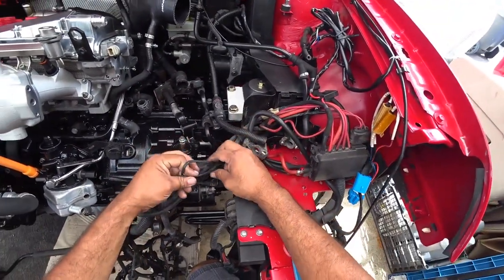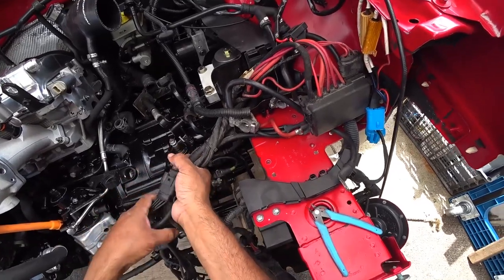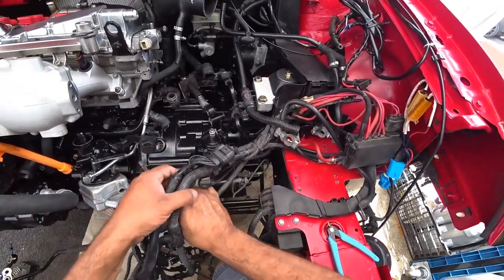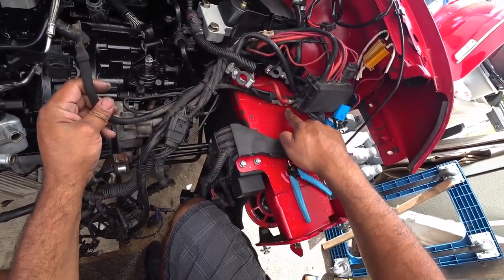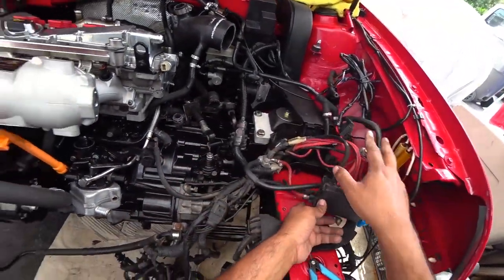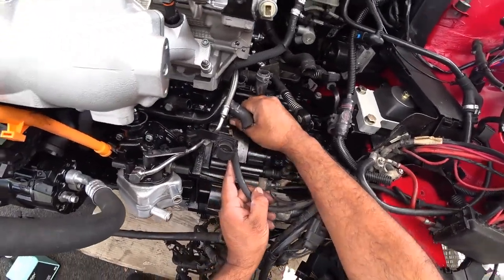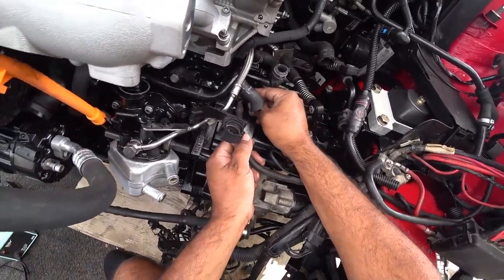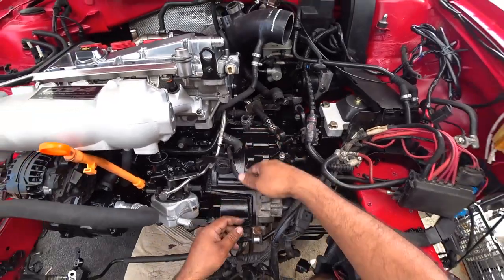Since this is already here, we're going to loom it in towards the end and get it all nice and snug with the wiring so it doesn't look bad. There's another wire that branches right off of it — this is a ground strap. This goes right down here and hits the ground, then tees off onto the battery post. This guy plugs in right here on the transmission and bolts on right there.